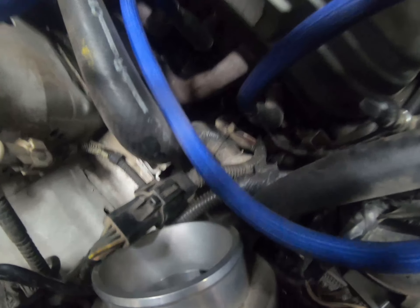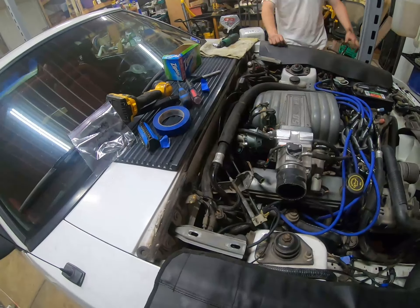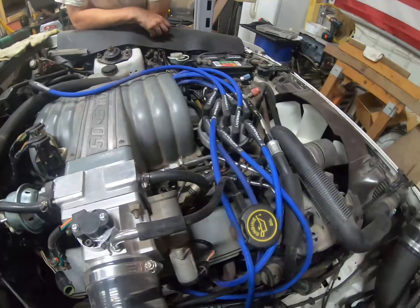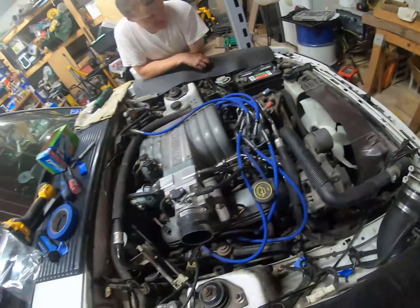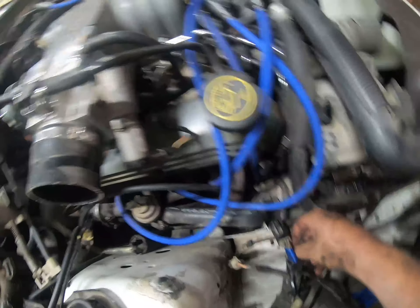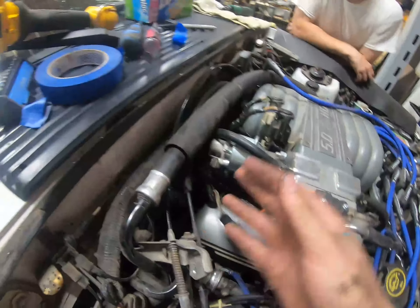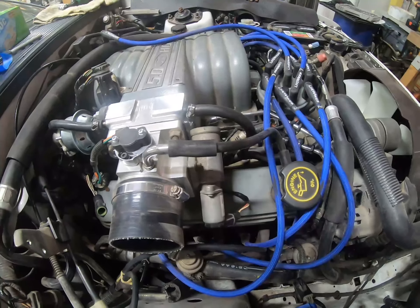You can see that one O2 wire is really chewed up — it's frayed out badly. We've been taking stuff off: removed the injector harness and everything else up here, removed the vacuum lines, removed the throttle bracket, removed the throttle cable and undid the bracket, and undid some more connections. I'd suggest — because we're switching to a Holley Terminator X intake — if you were keeping your original harness, you'd basically want to tape the stuff like we're doing here and put a little note on there, like 'this is for the alternator.' We're just going to keep plugging away finding things to remove.